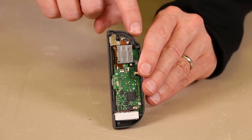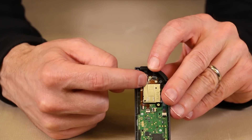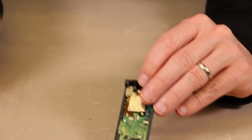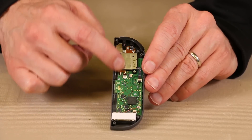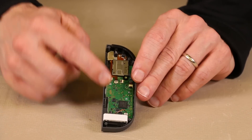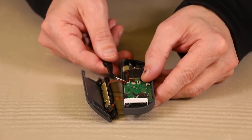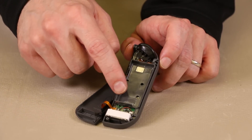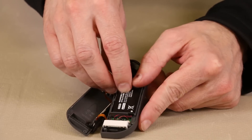Now that those buttons are in, we need to install the L button that goes right up here, making sure that we get the spring in the correct place. One of the ways you can do this is set it so the spring is kind of out of place but the button is lined up correctly, and then just move the spring into place using tweezers or something really small and flat. And there we have our button in place — and as you can see, it does click correctly. Now it's time to install the gray battery holder and install the screws, but first we're going to plug in the rumble strip motor into its connector on the motherboard. We also need to install the back of the controller and the ribbon cables right here and right here. Now that our battery holder is installed with its ribbon cable and three screws securely installed, we'll reinstall the battery, making sure that it's pushed all the way on, and then we just lay our battery back where it was and make sure we stick it down as firmly as we can back onto the adhesive.